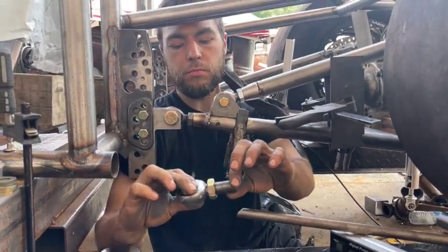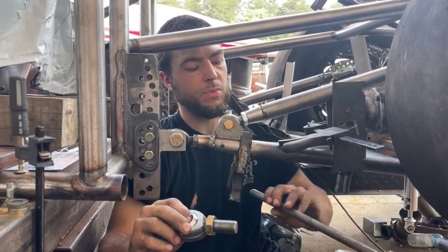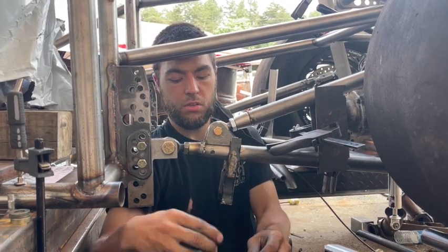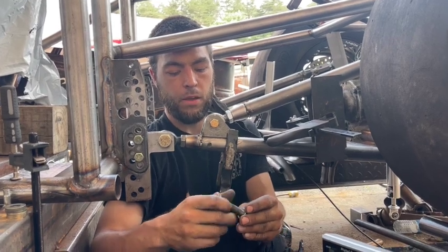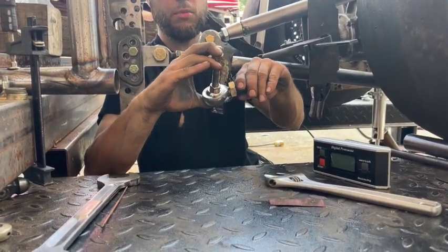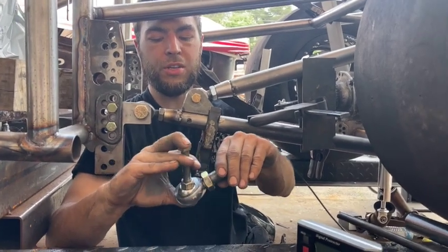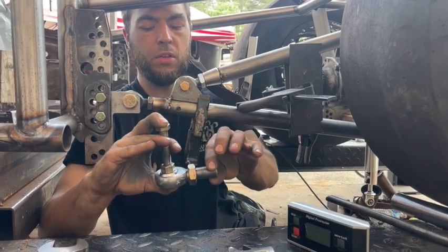For something like what we're doing where we have a lot of suspension travel, you have to start running like bushings in here so that you get a spacer in there and get a little more travel out of it. Instead of having the head on the heim joint, you can put a little spacer in there to get a little more articulation, but you're still dealing with suspension travel in one direction and side load — rear steer — in the other.